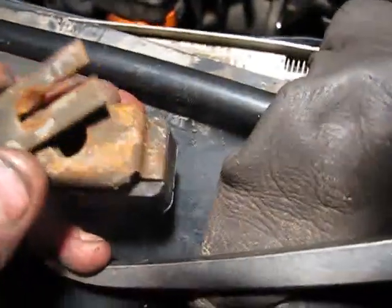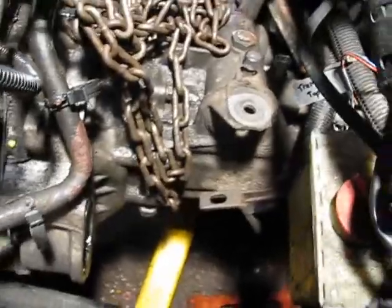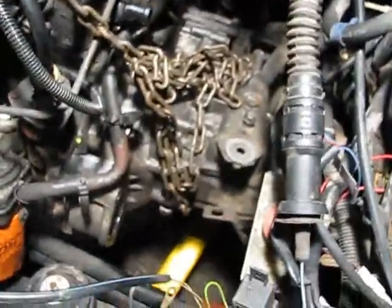You gotta pull the cable down, slide this clip out, and then let the cable go and it'll friggin' pop up. I'm pretty sure I'm gonna hate putting this back in though. I think I just have axles and power steering hoses to do. Oh, and that one coolant hose still. And then like I've said before, Bob will be your uncle.